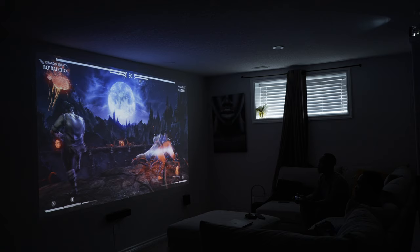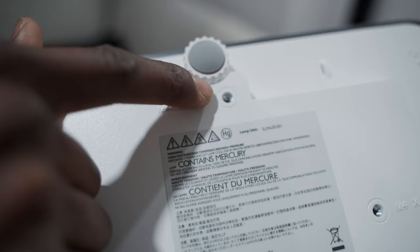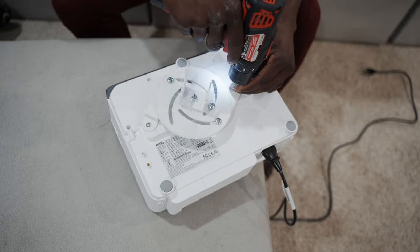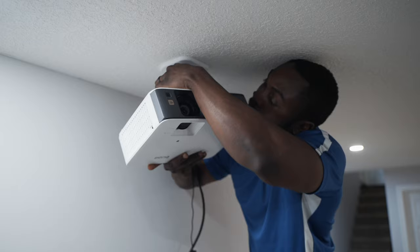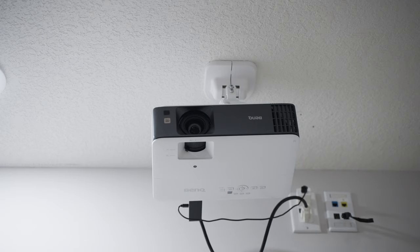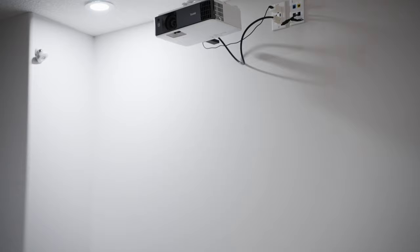Keep in mind that the larger the image projection, the higher the impact on the overall light output from the projector. Mounting can be done using three 8mm M4 screws and a separate ceiling or wall mount accessory, which you'd have to buy separately. We had a projector up there initially, so we just replaced it with this one. If it's your first time mounting the projector, you'll have to drill into your ceiling to get it up there. You can also just place it on a shelf, table, or something similar. The TK700 doesn't have a vertical lens shift, which can be an issue during installation, but not necessarily.